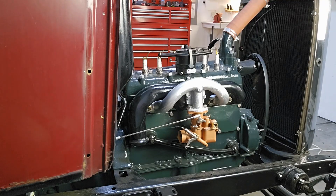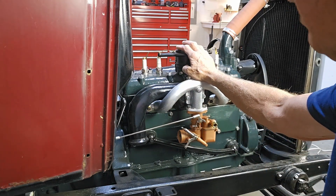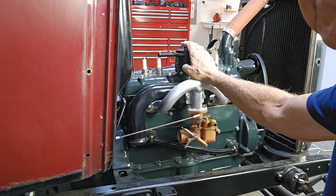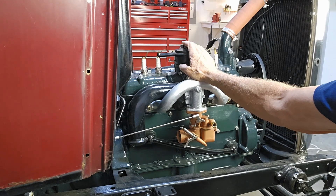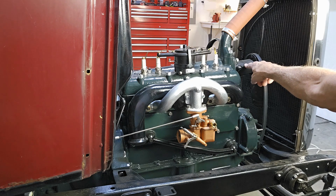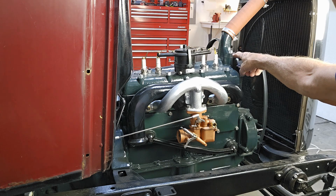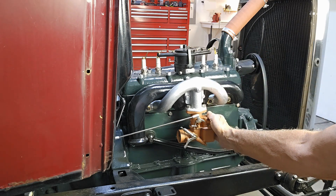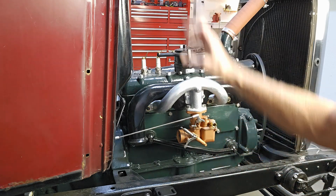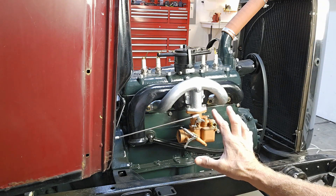On this side of the car, we have our distributor that's been rebuilt — it has the upper and lower plate with no connecting wire; there's a different mechanism inside for the plates to touch. We have a leakless water pump — the front bearing still has to be greased, but in the back it does not. We have our Marvel Schebler carburetor that's been Cerakoted and fully rebuilt. All I have to do is adjust it once we get fuel into it, and the throttle linkage works fine.